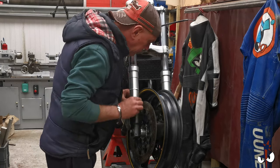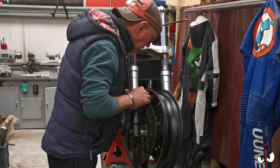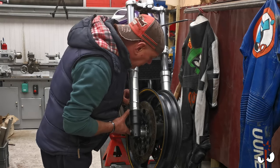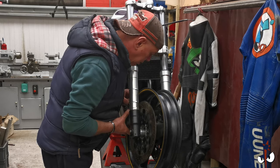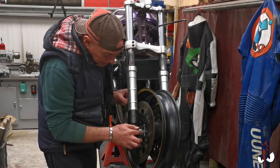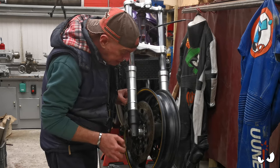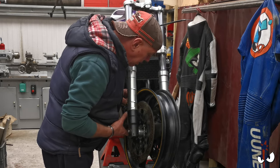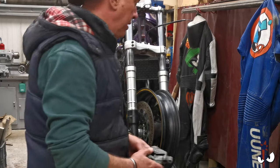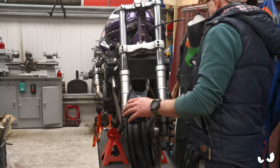How wide is this? Yeah, it's like half that thickness. All right, we could work with that though. So when I make this spacer up, I need to add half a washer's thickness between there and the race. That will put it smack in the middle. And hopefully this one is going to be the same sort of thing.